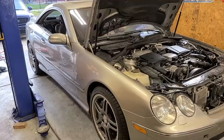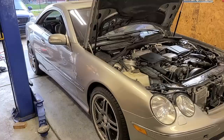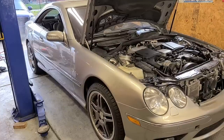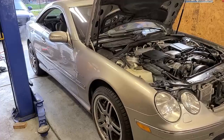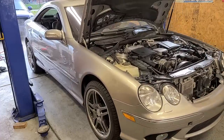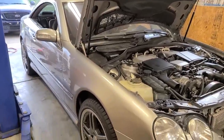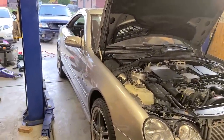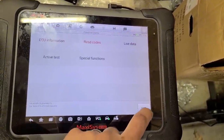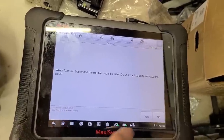Disconnect the multiplexer and let's just fire it up again. Let's put it in gear. Hold on a second — it went higher? Did this thing default to its highest position again? It looks like it's defaulted to the high position again and it won't tell me in the cluster that it's going up or down, but there's no warning light. Let's get back to the computer. No codes. Let's go into active tests — let's start a rodeo and see this thing dance. We still have good pressure.